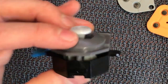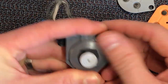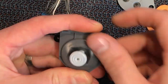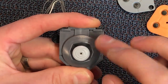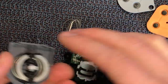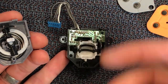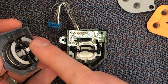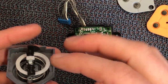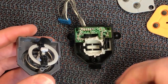Hold it with your fingers and you can feel the joystick tension — it's actually pretty good now. Those new parts have really tightened this whole thing up, and slightly stretching the spring helps as well. But there is one more thing we can do. If yours doesn't come back that good, just pull it apart a little. We know the white bowl was worn out and all the powdery plastic comes from that bowl because the end of the joystick rubs against it all day. We really need to build the surface of that bowl back up or extend the surface of the joystick just a little bit.